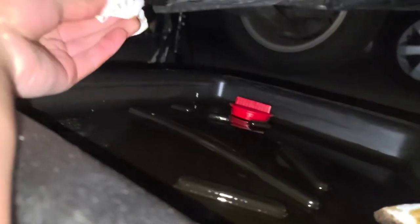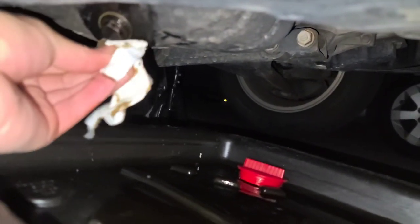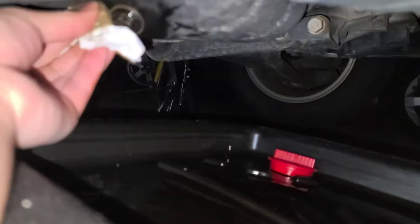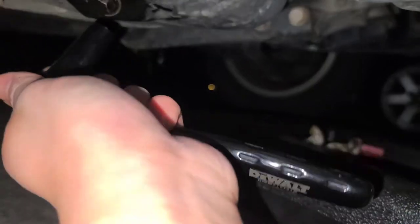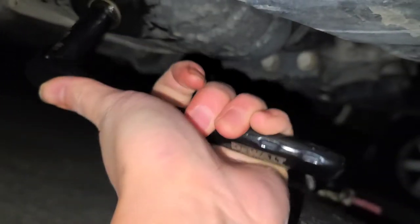Hand tighten it as tight as you can — I already got some paper towels here, so I'll use these, but you want to clean the area around there. Just clean it all up. After that, push the drain pan out of the way, grab the wrench. Make sure to switch it so that it turns the bolt clockwise now, and then just tighten that up. You don't need it super tight — you can actually damage or crack the plug if you over-tighten it.